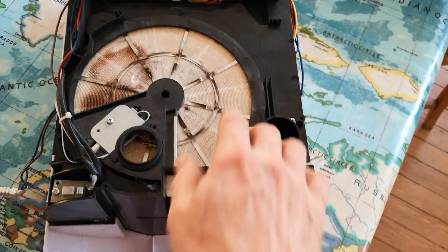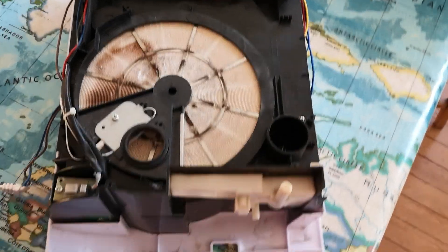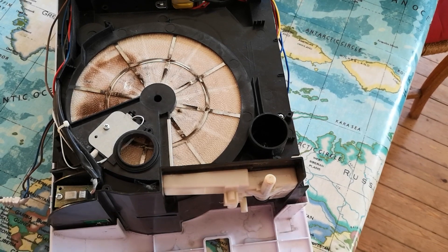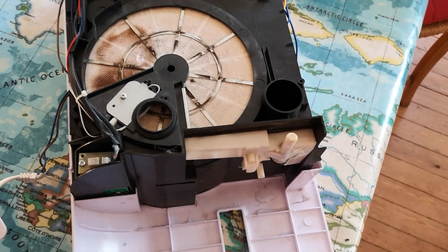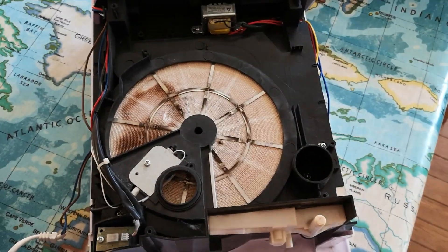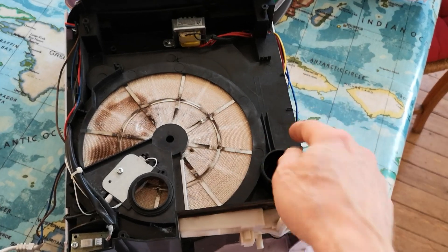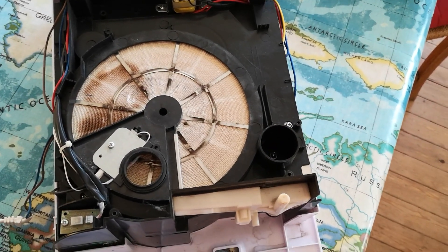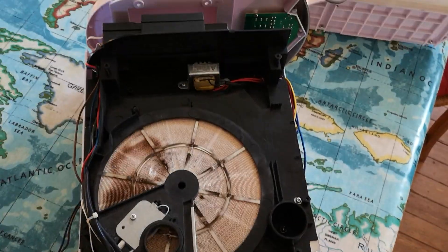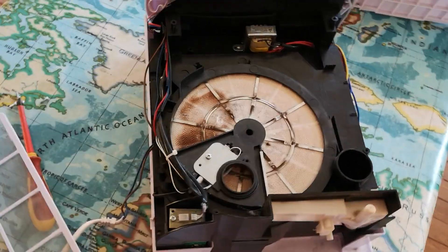I've got concerns over the efficacy of the desiccant chemical now, because I don't know whether this stuff ever wears out or lasts forever, but it does seem to be doing some condensing so I'm going to run it for a while. On the other side is just a fan blowing air through - a large impeller fan - which is still in good condition, bearings are good. So for £2.90 and a one pound bearing, I think I've got myself a desiccant dehumidifier.